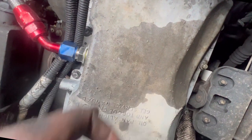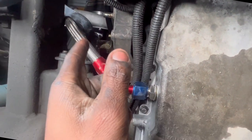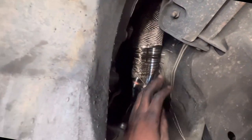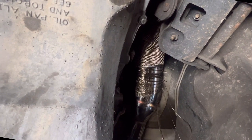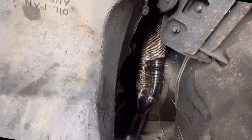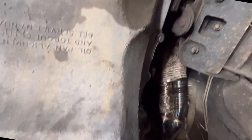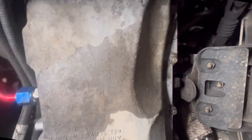We got our gasket on and I'm torquing all these bolts down. We got everything routed from the drain pan all the way to the turbo up top. We got both sides of the manifold on. I got to finish wrapping this up — AutoZone ran out of the header wrap, which sucks, but we still got to finish it. I was going to put the hooker pipe across but I'm going to wait. Found a good stopping point — that's it from under here.